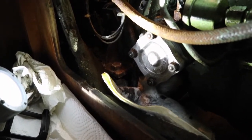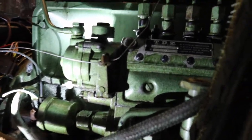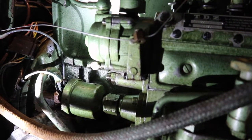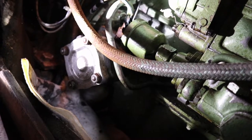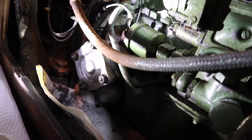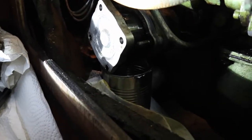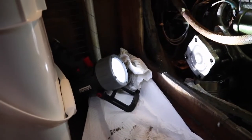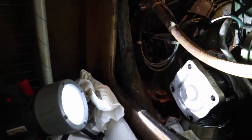Here's the access to the oil filter — that's it right there, that gray thing. This is the fuel pump, the TDZ version that is fitted on many of the OM 636 Mercedes diesels. I'm going to open that up now. Oil will probably fall a little bit on the bottom but I've got a cloth set there, then I'll pull out the reusable filter, put it in a bucket, and clean it with diesel. The bolts are 13 mil — you can see the 13 mil socket to take those four off.